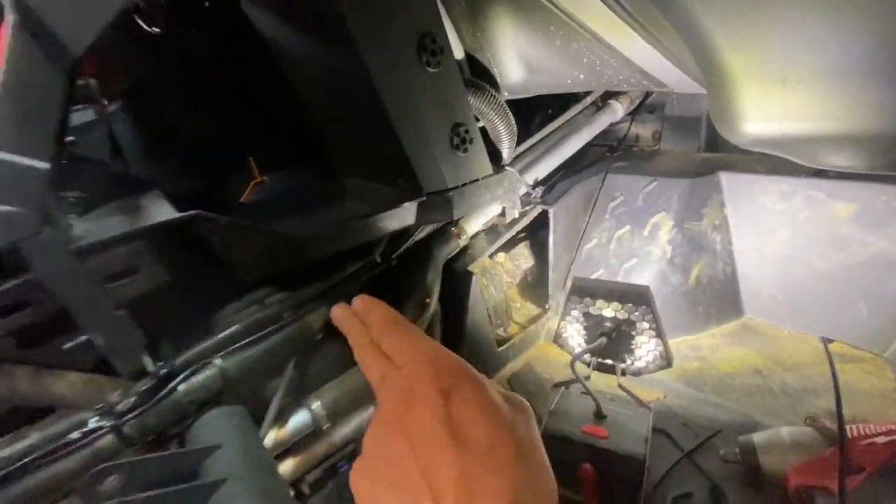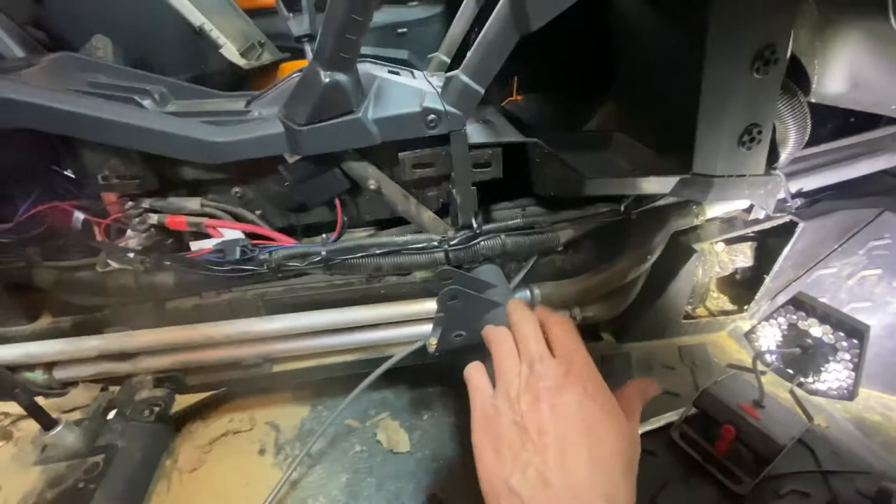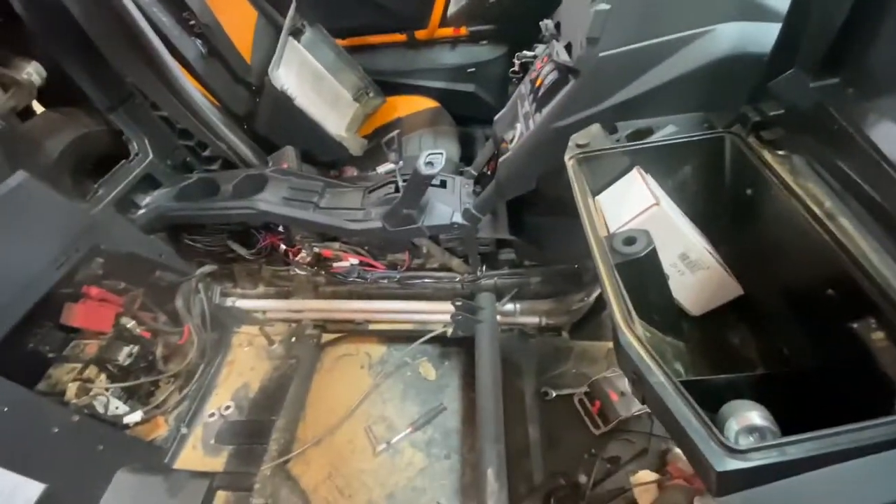Run your wires back through your firewall and in through the shocks area. With the little reservoir tank it's hard to get the wires through there, but they will go. Push your wires through the firewall, bring them in through here, and run straight back all the way over to your bus bar. I tied in a switch and put it up here so I can flip them on and off, and then you can use the app or the remote control to scroll through power and colors.